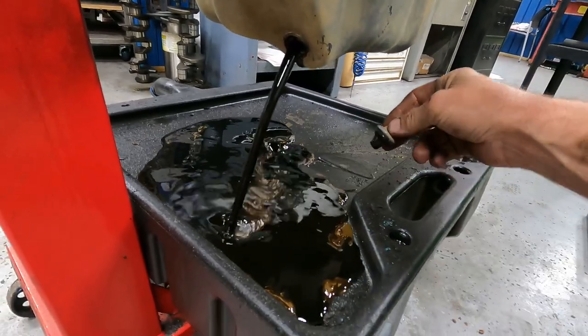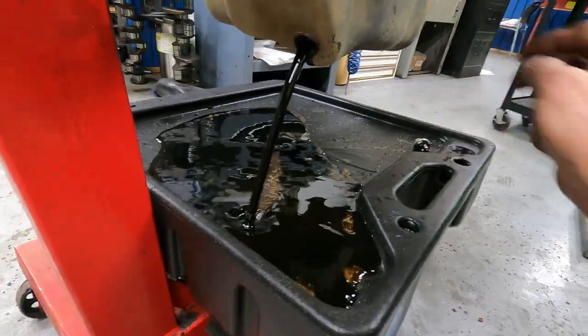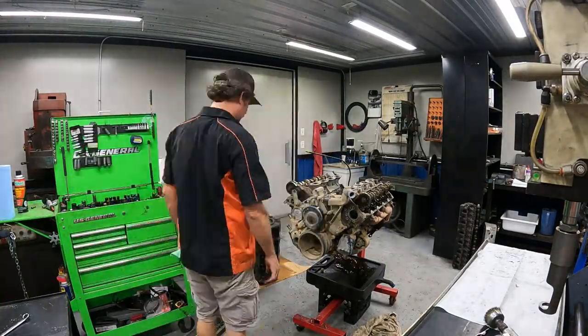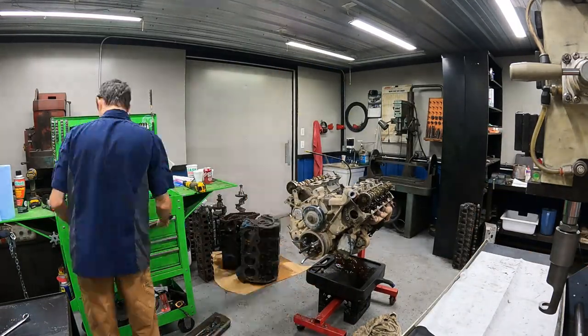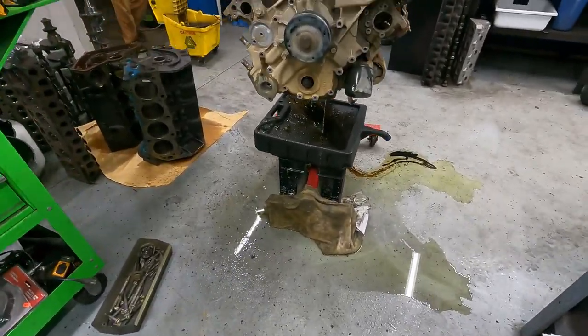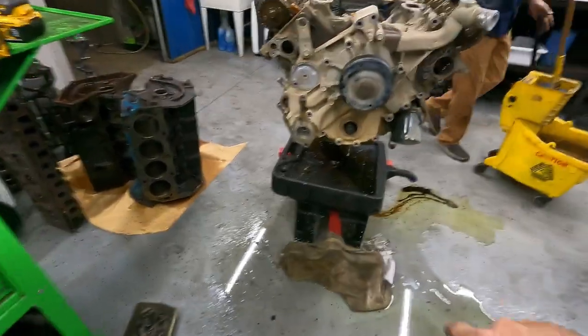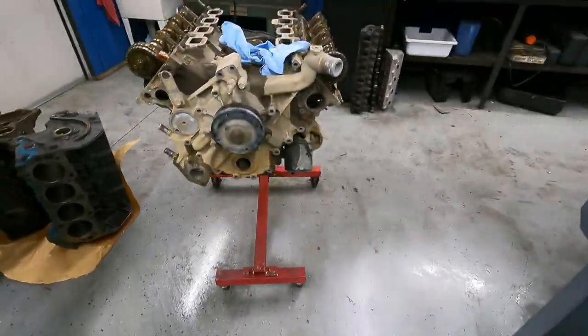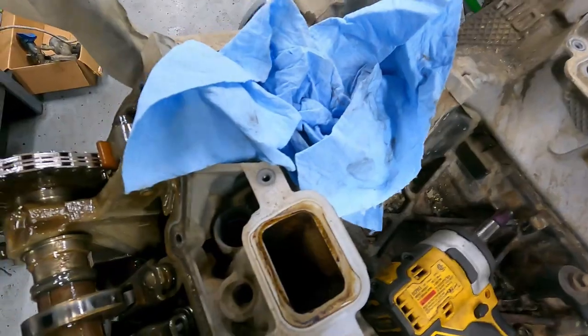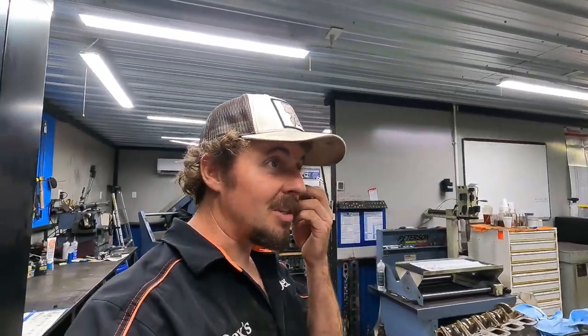Just a pinch of water in the oil — so that's not bad but not good. I'll start taking it apart and holler back when I know something. I popped the 4.7 valve cover off — the oil was full and it was running through. I'll turn the light on. So far we don't have any dropped valve seats, which is the best scenario.